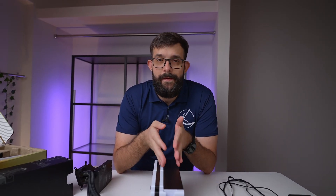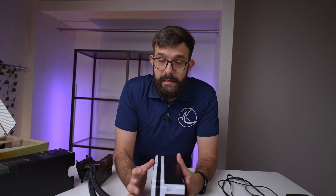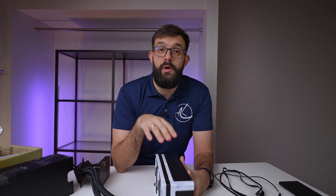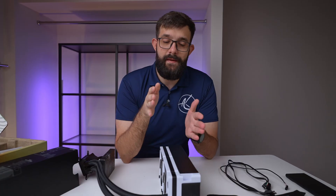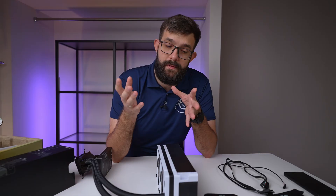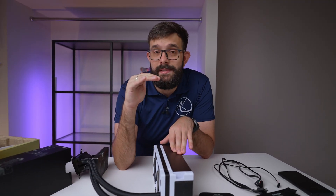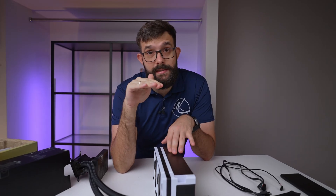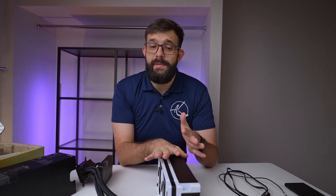In most cases, something this thick may not actually fit — and this is one of the biggest problems with this kind of design. Compatibility with a 240mm radiator in terms of length is normally not a problem, but thickness is where issues arise. Most fish-tank style cases are designed for this and work well — and that's actually what Hyte built this for: their own fish-tank style case. But for the general public, most cases don't have that much clearance. With normal cases, something this thick will basically be touching your VRMs or halfway through them, so you need to verify compatibility carefully.